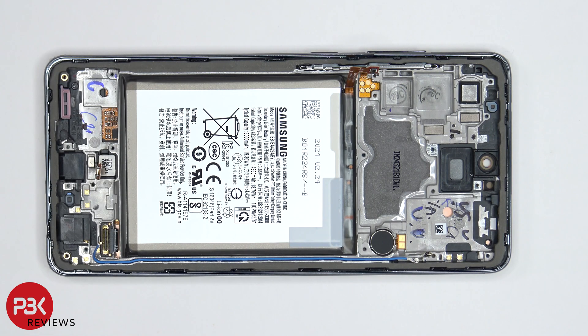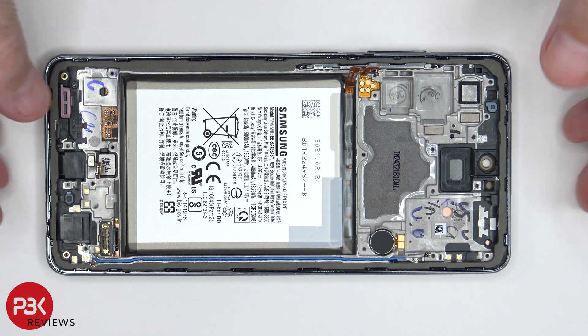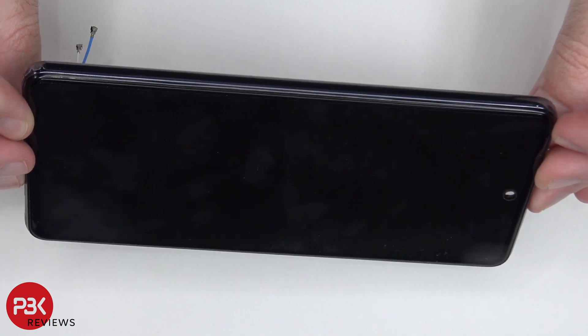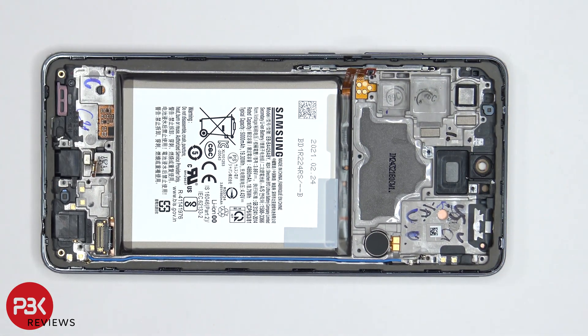Most replacement screen assemblies come with a mid-frame pre-attached. However, if you get a screen assembly without the mid-frame and you need to replace your screen, once you've removed your back plate and top and bottom covers, and removed the speaker assembly on bottom, you would have access to your screen cable which is located right over here. At that point, you'd heat up the phone from the front side where the screen is, so you can loosen up the adhesive underneath the screen. Then you'd pry your screen off your mid-frame, get your new screen, apply new adhesive, making sure you run your screen cable back through the opening over here, and then you attach your screen and reassemble your phone.